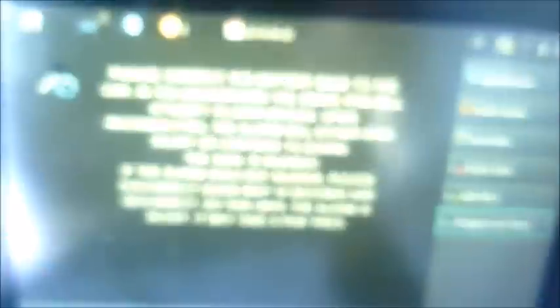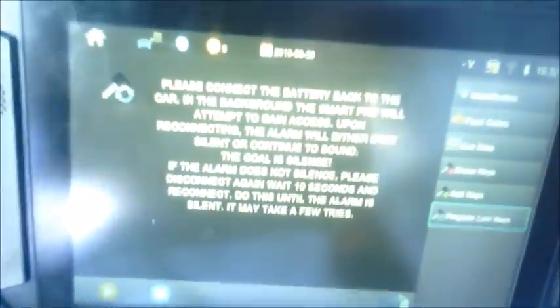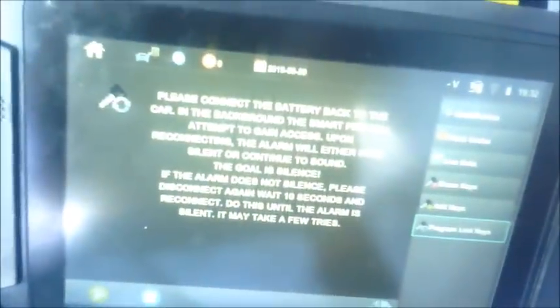So I'm going back to the battery and I'm going to reconnect the ground side. The important part is when you connect it, you want to stay connected until you've determined whether the alarm is going to remain silent or not — don't connect it for a second, have the alarm go silent, and then disconnect. There was a large click from the engine compartment and that's what you want. Go ahead and tighten this back up — that's a 10 millimeter socket used to disconnect the battery. I'm going to close up the hood and come back to the tester.